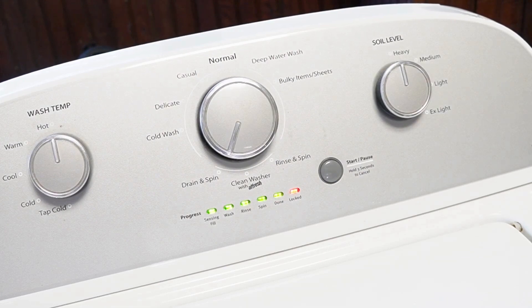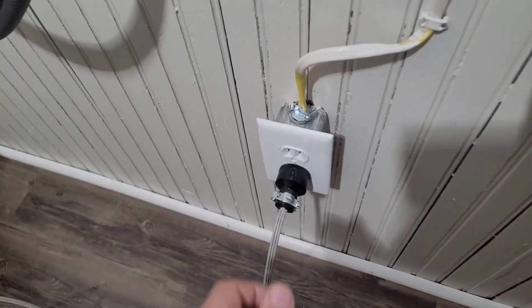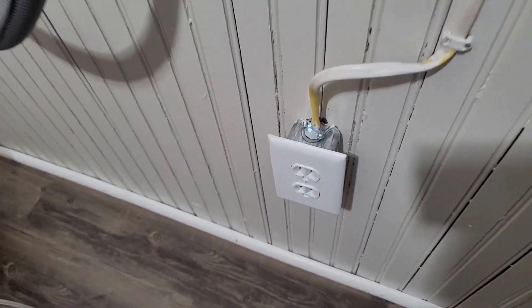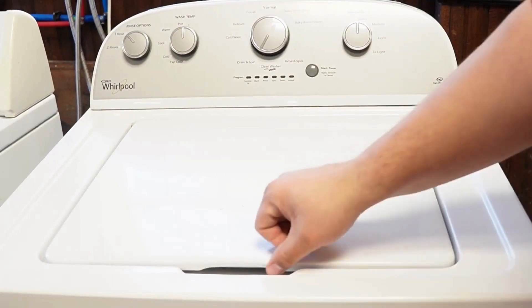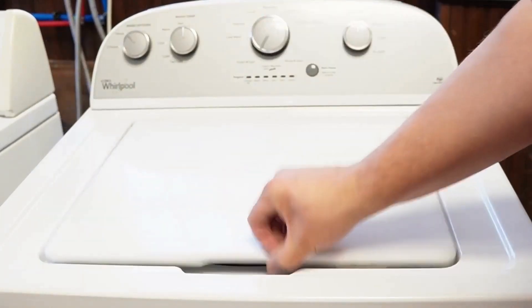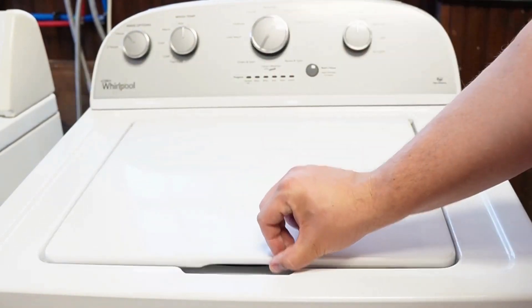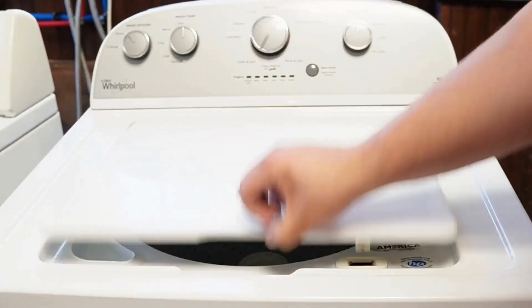When the calibration mode is at the end, every single light is going to turn off, including the lid lock light, and the machine is now ready and recalibrated for use at an optimal level. Now let's try one more reset technique. You'll need to unplug the washing machine and let it sit for about one minute to drain any capacitors or memory, just like we did the first time. Then plug the washing machine back in and let it sit for a few moments. Then open and close the lid six times in under 12 seconds. This works on some but not all models, and it will issue a reset command to the washing machine to clear any issues beyond what the reboot or reset mode did.